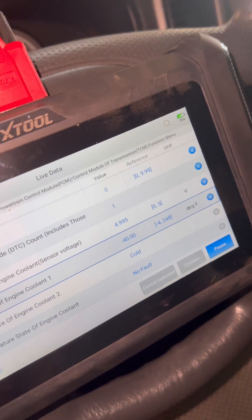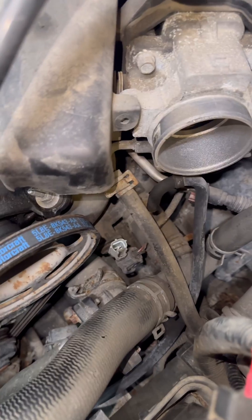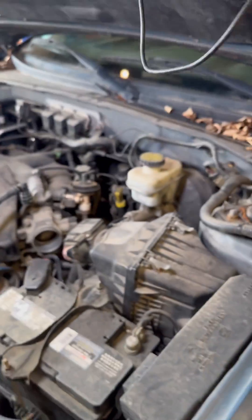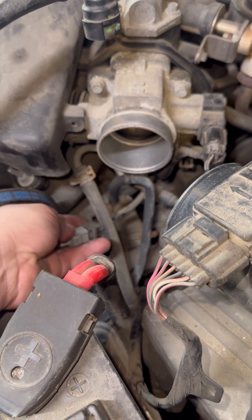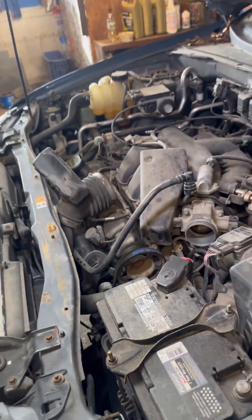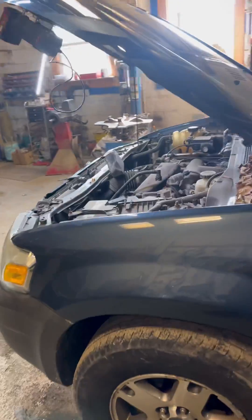Now it's maxed out at negative 40 degrees — the minimum — so it appears the wiring is working and we have a bad sensor. We can verify that quickly by testing resistance on the sensor against the spec for its temperature. We've got a new sensor. Remember, we were bottomed out at negative 40 degrees max. Let's plug this new sensor in and see what the scanner shows. Once plugged in, it should read much closer to actual engine temperature. We walk over to the scanner — bada boom — dead on. My garage is set to 60 degrees and now we're reading correctly. Definitely a bad coolant sensor.